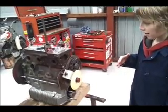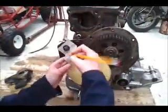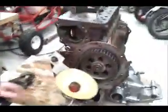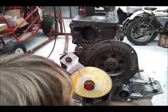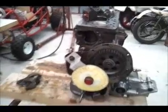What we're going to do is find top dead centre. I'm going to use 10 thou, so you have to put the marker on the DTI on 10 thou — you can use whatever number you want — and then you mark where the zero is. You bounce it off zero and then you find ten again the opposite way. Then you mark it, and the one in the middle is the top dead centre of the engine.